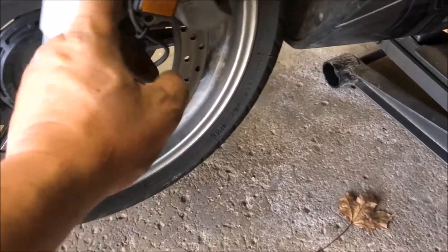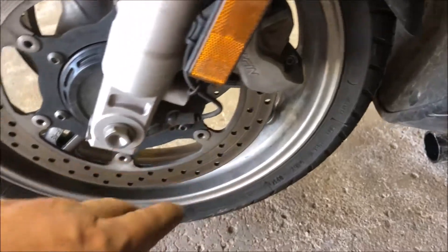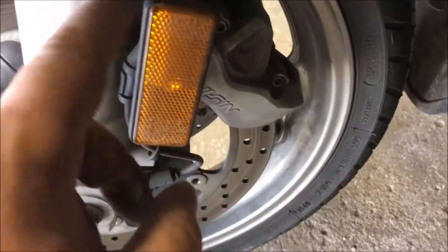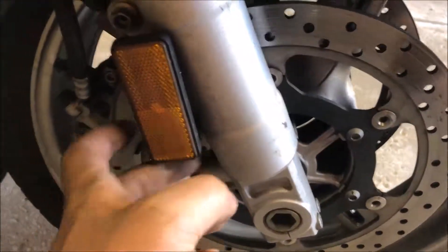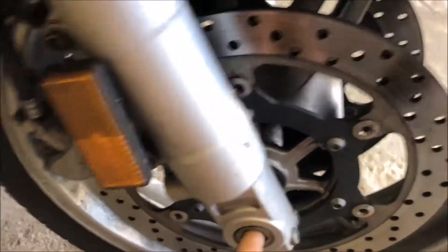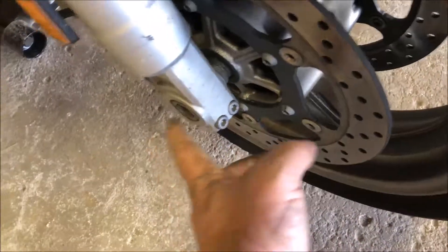You have your front ABS sensor right here — we'll pull this off and pull the reflector off. We'll pull the caliper off here, and on this side we'll do all of that. This caliper actually comes off right here. Then we'll loosen these two bolts up, come over here and do the same thing — pull the reflector off, the two calipers, loosen those bolts, and remember your washers.